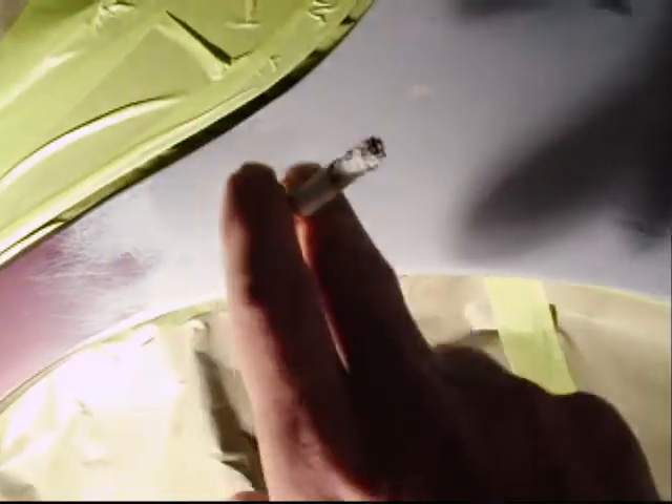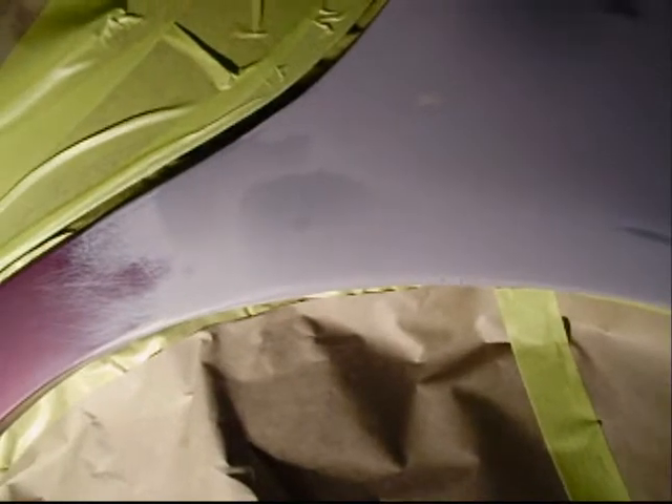We had the rear quarter which had a good-sized dent in it. We got some before pictures. Got that all fixed up. There's a little discoloration here — self-etch primer where I broke through. I just sprayed some self-etch on there, and there's a little bondo or glazing putty spot there. That's just primer — self-etching going through there.